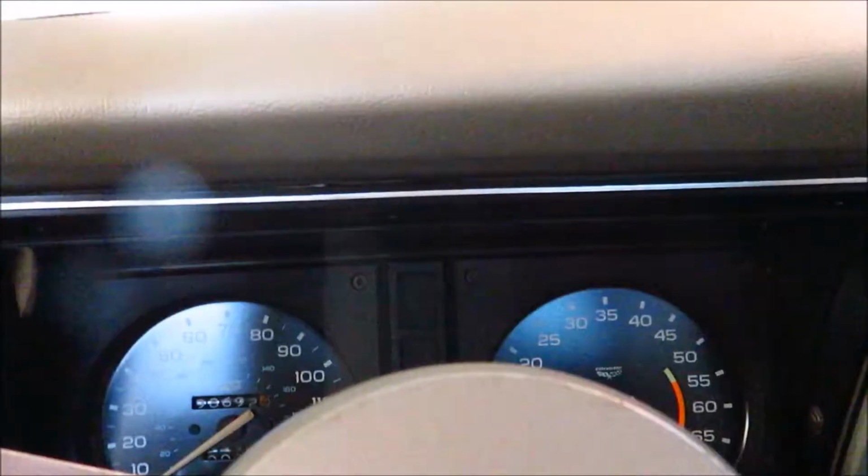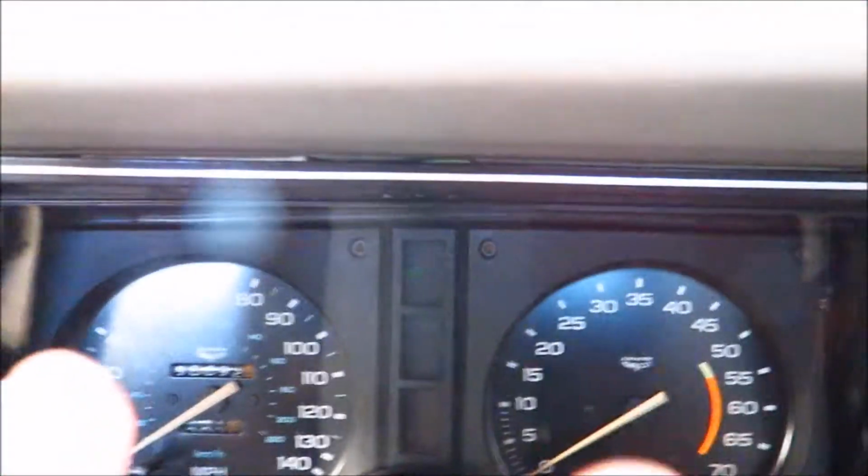So now I'm down on the passenger side, and I'm looking for a directional switch somehow connected, and I'm trying to figure that out. But here, let me put the hazards on real quick. So the hazards are on, and you can see normally both of those blink left and right, but just that one. So I'm pretty sure that bulb's burnt out.